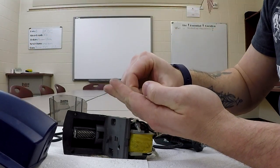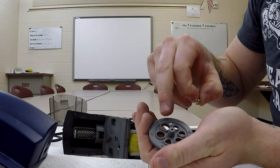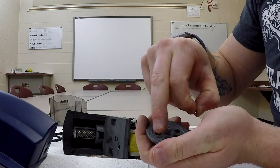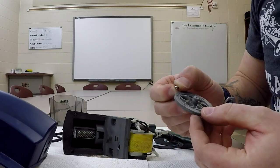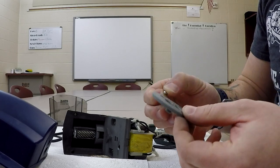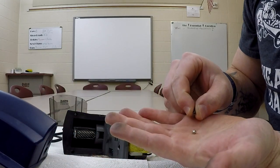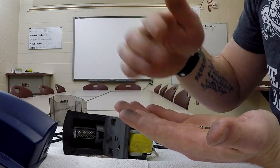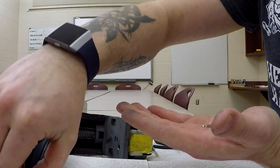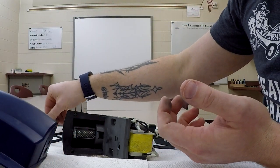And inside, typical detent setup, we have our plastic wheel, and you can see these little hemispherical shapes in here. That's what the ball detent sets inside. So this is like a nylon or an ABS as well. All right, set that aside, and then we have a small ball bearing and a spring. And the spring, of course, pushes the ball against your wheel, and that's what locks it in place. Kind of a standard arrangement, so we'll set those aside.